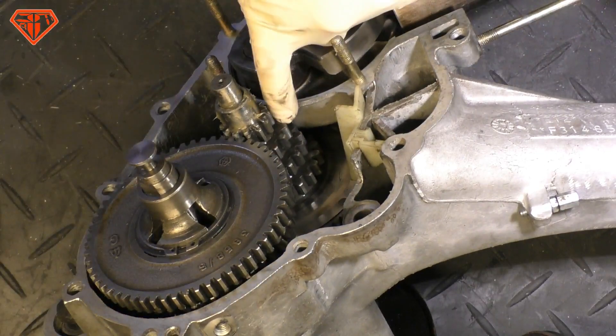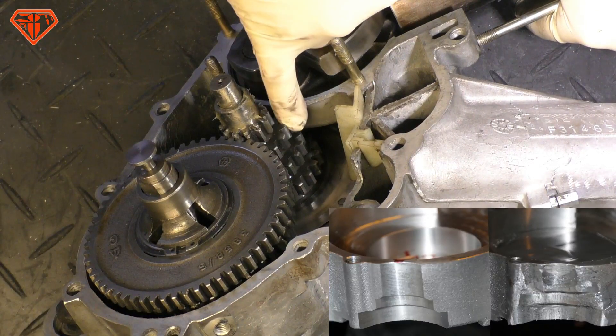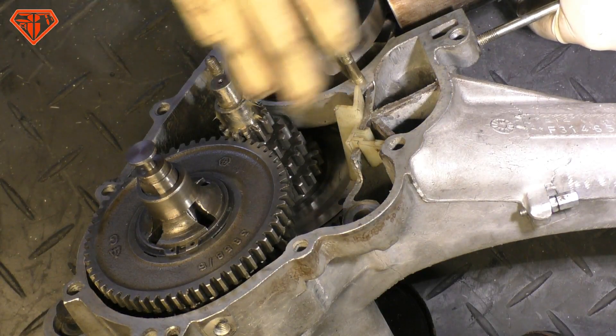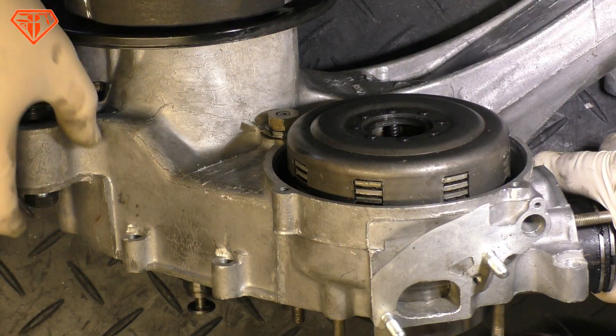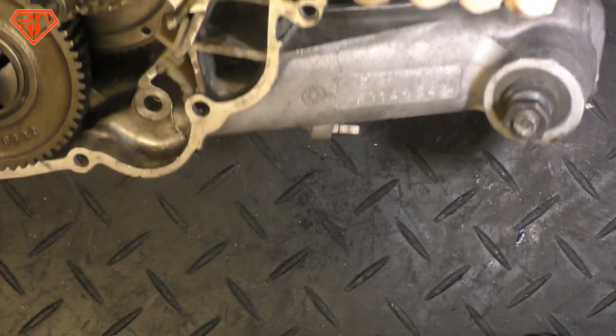And the other thing is the spot for the primary gears here, so that the primary gears do not strip the engine case - that's also part of the cast. It is possible to include the correct shape and clearances already into the cast if you want to do so.